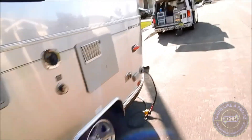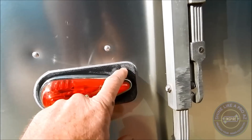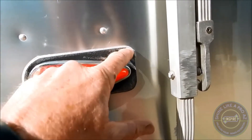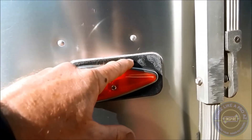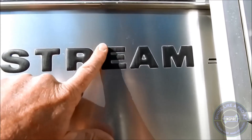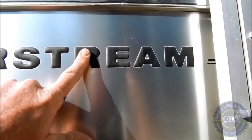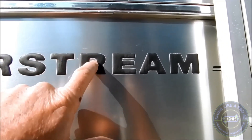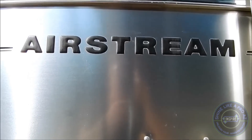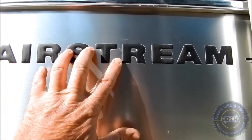Because this staining is so extensive, let me show you another area. Right here around this lens is some excessive staining from wax. I'll have to use a little scrub brush — something as simple as a toothbrush — with straight rubbing alcohol. Now some plastics or rubberized materials like this, the alcohol will start to break them down and they can turn into a gooey type of feel. This is a case-by-case judgment call. I could apply the product straight over this and still get good results, but I want better results, so I'm going to clean it up with straight alcohol.